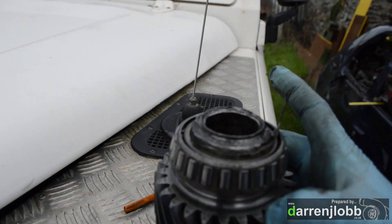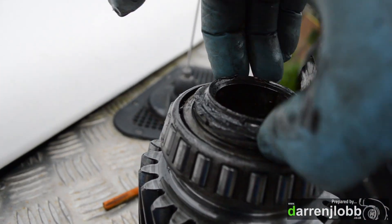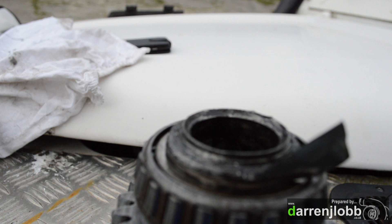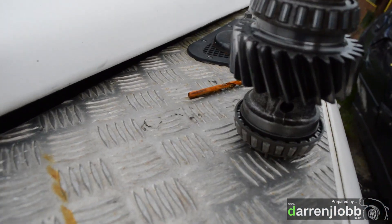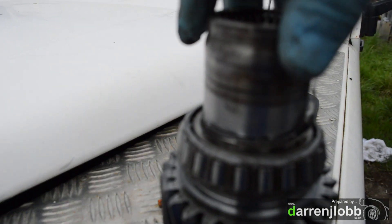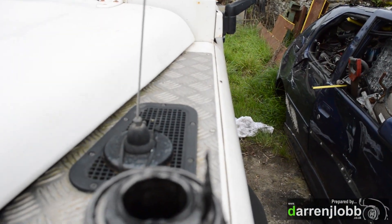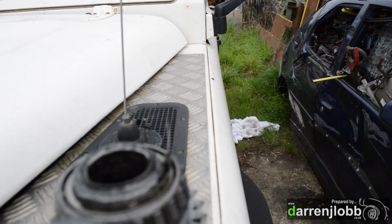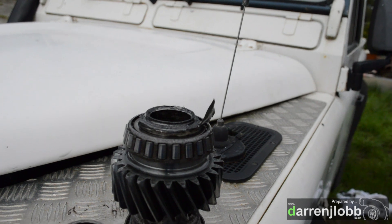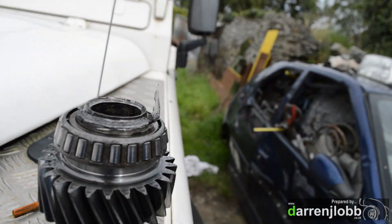You can see that's where she's sheared. I'm not really sure what this is all about — it looks to be packing the bearing out. There's the other half obviously, that was on there somewhere. I don't know how, because she slipped when I was going up a hill and I thought the clutch had slipped. I let off the power, she gripped again and must have found something to grip on. She pulled me up the rest of the hill, then when I changed gear again she stopped gripping and I had a box full of neutral.